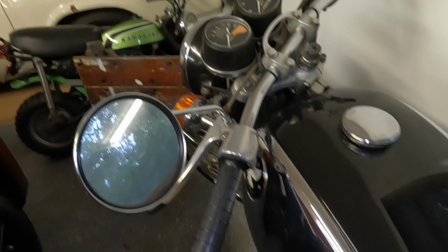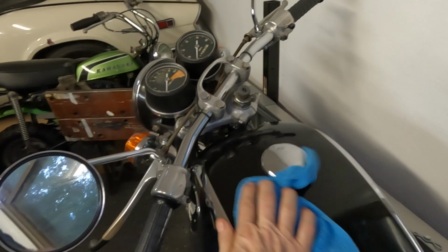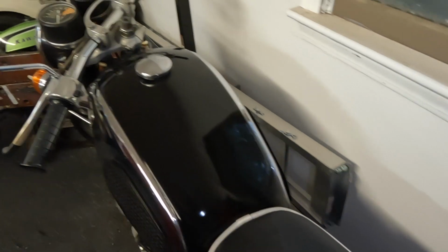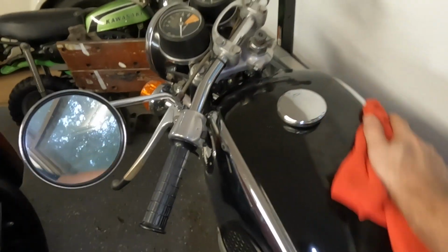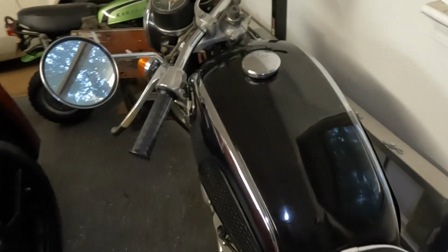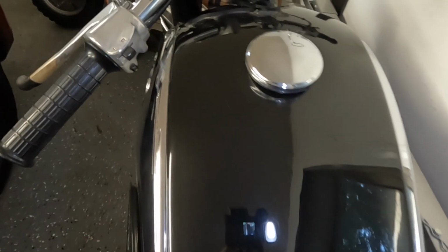Again, it's not perfect, but I did it in the same paint booth that I'm going to show you in just a second. So let me wipe this off. This just has a little bit of grease and tar remover on it, on that rag from when I sanded everything. And that's pretty good for a Rattle Can. Again, this was wet sanded with 3000 grit sandpaper, then buffed and polished on top of it.